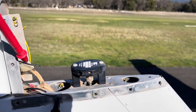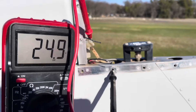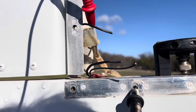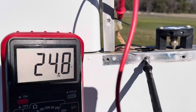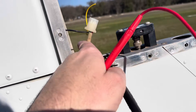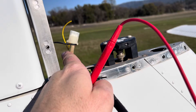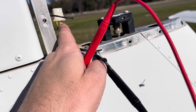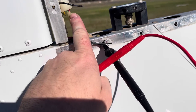Back on the airplane, we took a rag and cleaned up all the dust and dirt under here. We've got our meter and the beacon light switch on so we can verify which wire is which. It's hard to see through that little Molex plug, but it's the red wire — the red wire has 24 volts, so that's going to be our power wire. We don't need this plug anymore, and we don't need that yellow wire or the wire going to the old transformer resistor, so I'm going to cut it off and put a connector on the red wire.